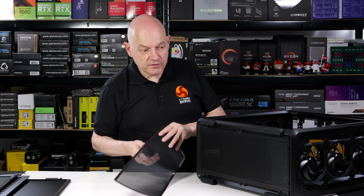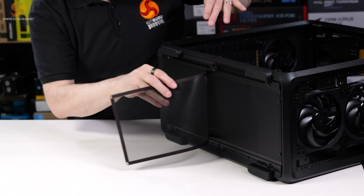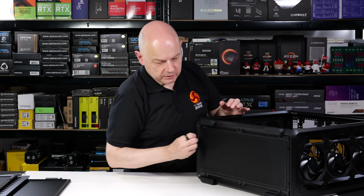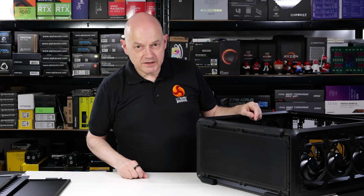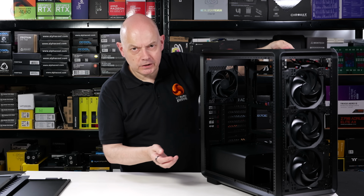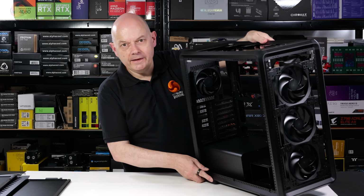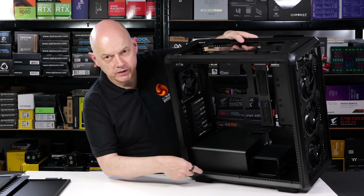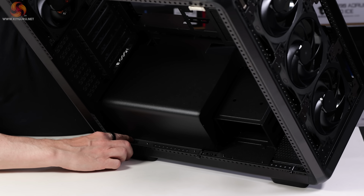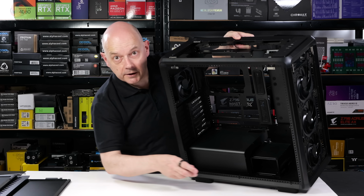In total 10 fasteners. And to replace the magnetic filter, it goes in this channel and between these 4 screw heads. Really easy to do, but it's one of a great many tasks with this case that aren't exactly difficult, but they do get fiddly. And the 6 fasteners, 3 each side that I mentioned, that go from the inside out, there, there, and there.